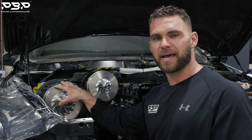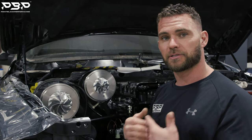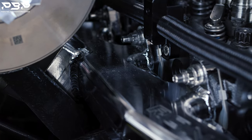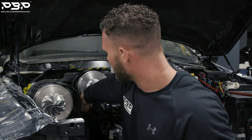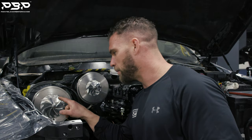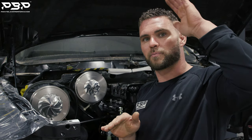So you would think, why not just put an 88 over an 88 — two big massive turbochargers? You don't want to do that because it's going to be slow, laggy, and it's going to drive terribly. Think of it this way: you've got a lot of exhaust gases — it's like a gerbil running a race. It spools up quickly in the smaller primary turbocharger. Once it spools quickly, it runs down into this big open secondary turbocharger. The gerbil hits it and goes; it finds no resistance. That wheel spins harder and faster, and it shoots all that forced air right in — making power. You want to keep the drive pressure low and the boost pressure where it needs to be. There's a ratio. For a better understanding, check out our Power Stroke compound setup video where I go into more detail. So this is an 88 over a 71 primary-secondary turbocharger setup.